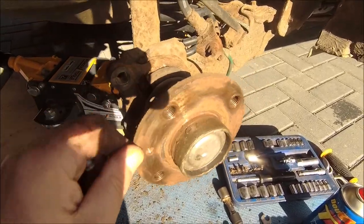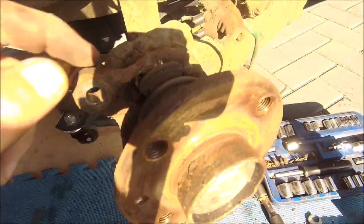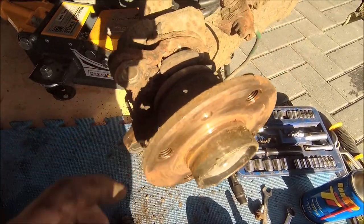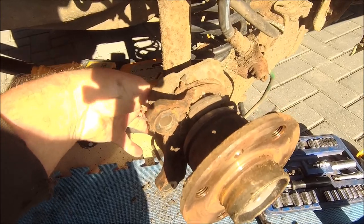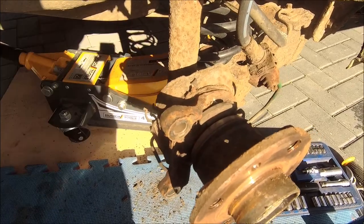Disc off, so now I know what I'm working with. That is the ABS sensor just there and as you can see that wire's just been chopped - whether intentionally or by accident makes no difference, it is chopped. That seems to be a magnetic pickup which picks up on a magnetic ring on the back of the hub itself. I could work on that wire with the hub in situ but I'd rather try and get this hub off to make it easier. I believe on the back it's those star drives again - once I figure out which size I'll let you know.